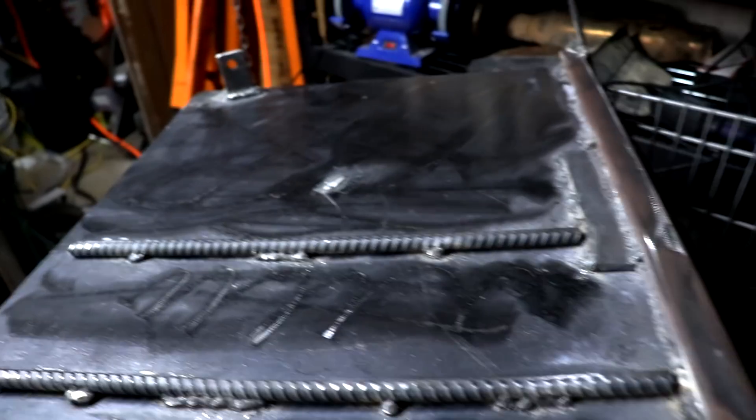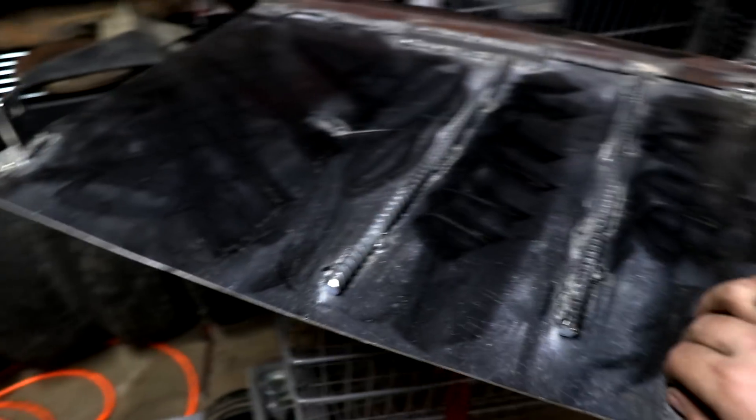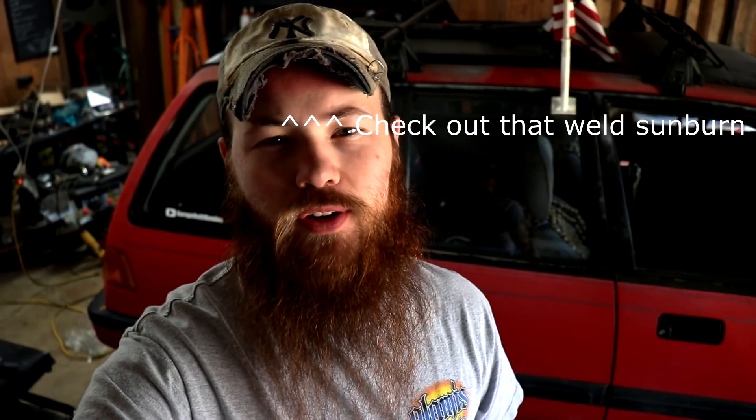The skid plate is done for now — I'm happy with it. I've got these gussets welded up, just some rebar I picked up and cut. Don't look at the shitty welds. The little bottom looks good — smooth. I beveled the edges underneath, hit them with a 45 on a grind wheel, trying to make it nice and smooth. It's day two — I'm going to throw a coat of paint on it just to keep it from rusting. While the paint's drying I'll do an oil change on the wagon since I was going to do it anyway and I need to drop it before putting the skid plate on. Also gave myself a nice little sunburn across my forehead — my welding cap wasn't all the way down when I was welding yesterday.